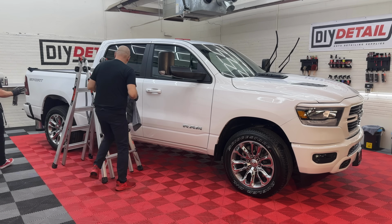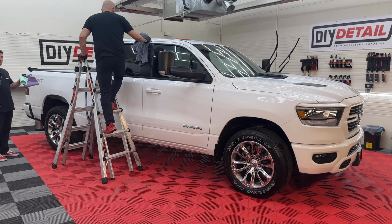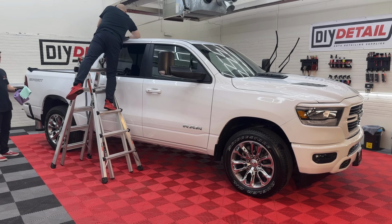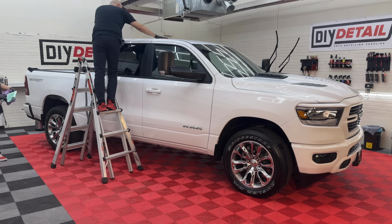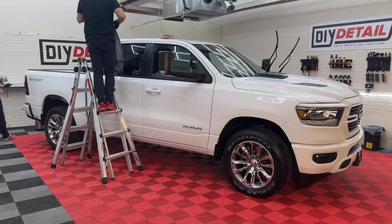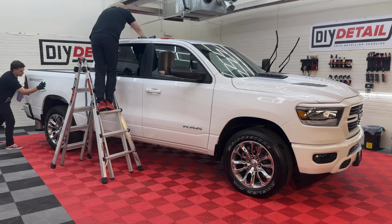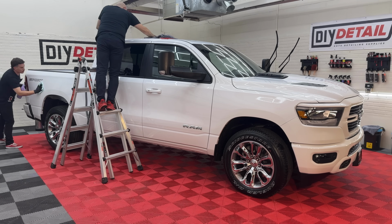Ivan, I'm doing panel prep now. I'm gonna be extra vigilant with panel prep because we haven't used a hose, we're not polishing. I gotta make sure I do this step right. So I'm not gonna spray panel prep onto the paint, I'm gonna spray onto my towel. And I'm gonna use 2 towels. My first towel is gonna be my initial wipe, and then the second towel is gonna be to follow it up. Exactly. A little bit of redundancy here goes a long way.